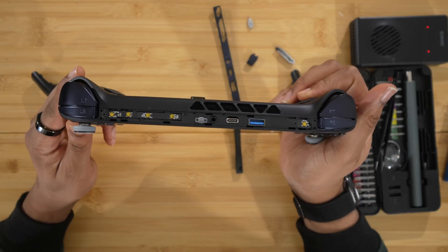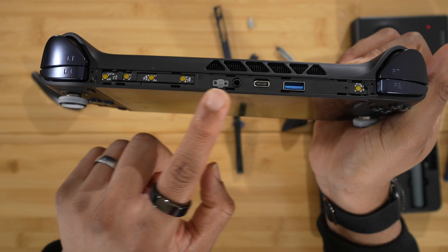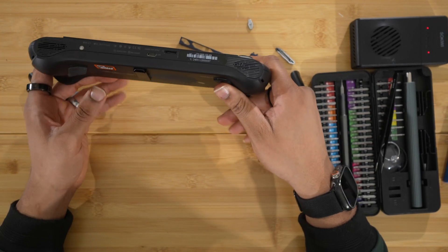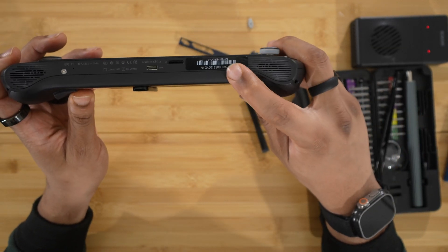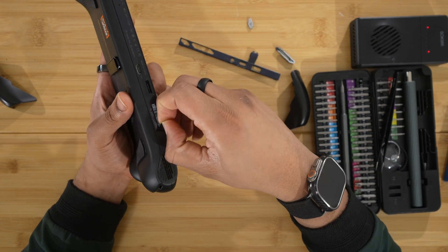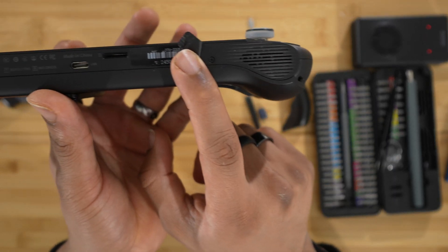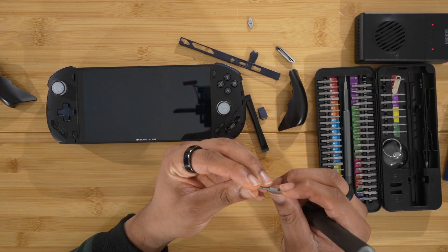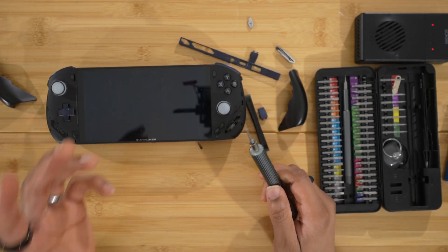Now we can see three screws on the top. There's a screw here, a screw here, and a screw here. But we're not done — there are some really sneaky hidden screws. There's actually a screw under this little sticker here and another screw under this other sticker. I'm going to peel up this sticker, which is just the serial number label, to reveal the screw underneath. Now we grab our screwdriver — this is a double-zero Phillips head — and we are ready to go.